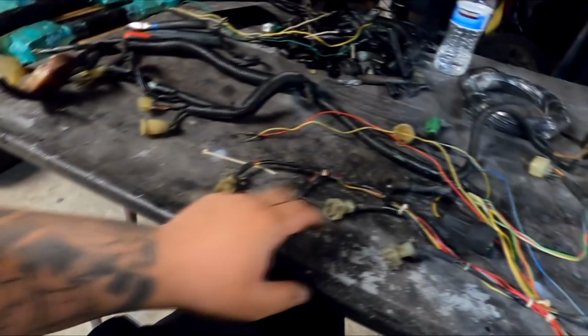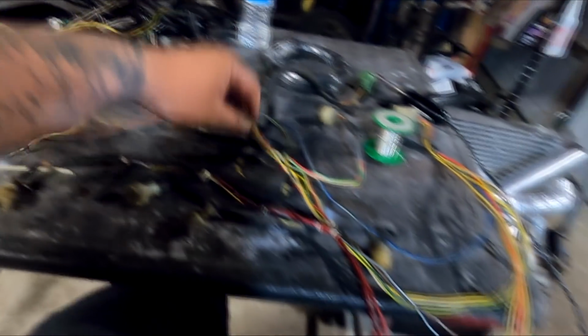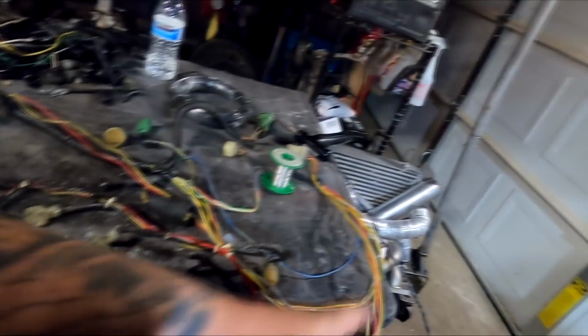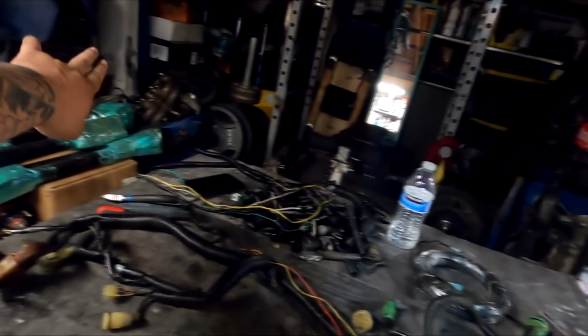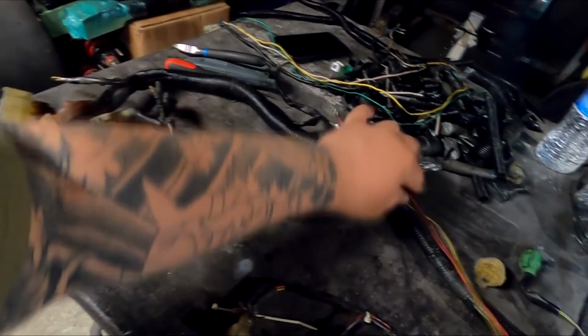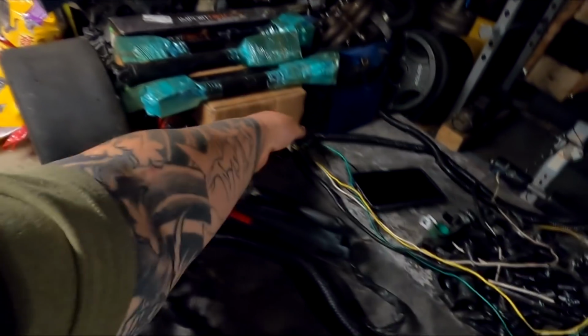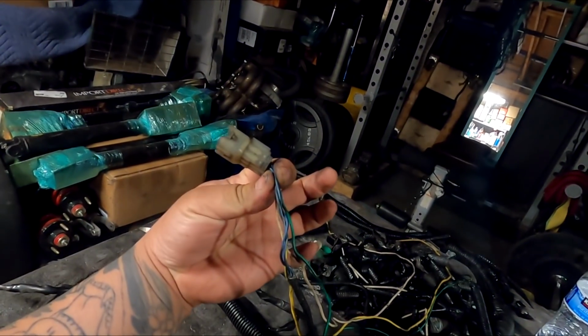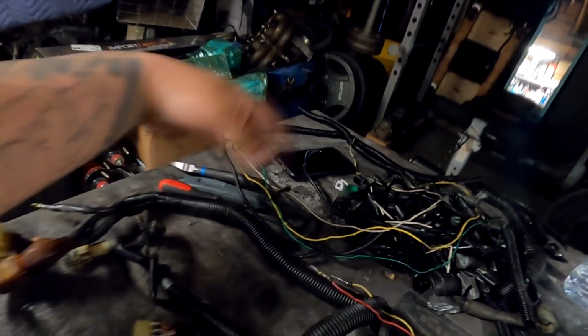Now again, you can check out the other videos for a more thorough explanation, which is a longer video, or you can check out the Angel Fire to understand what I'm talking about. The yellow and the red are number 2 and number 4, and you can see I routed it this way through the harness instead of routing it through the driver's side and then putting longer extensions all the way to the ECU. So this is going to go across the harness to the passenger side into 2 of these slots. 2 of them are going to be for injectors, and 2 of these, the blue ones, are going to be for distributor, and I'll explain that in a minute.